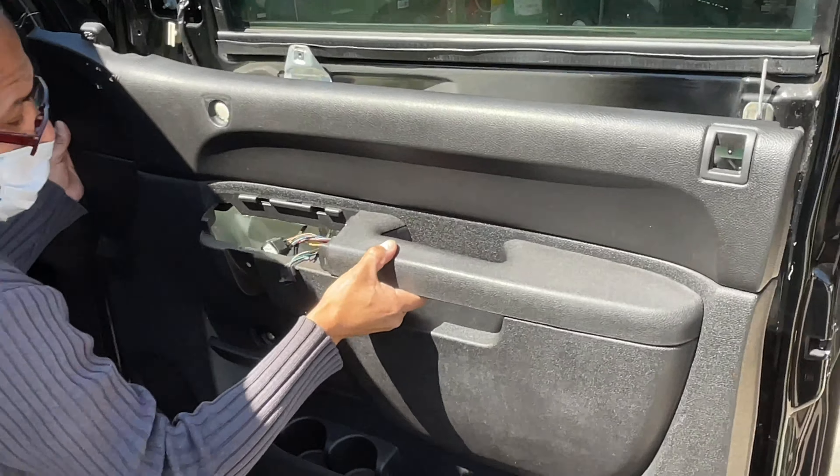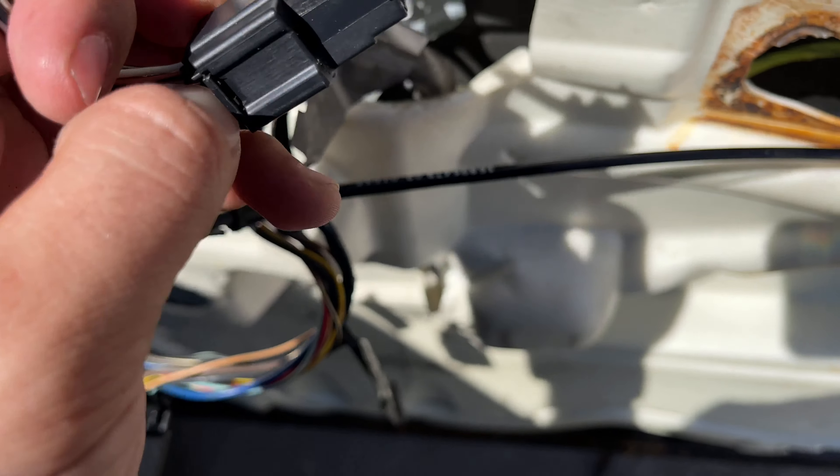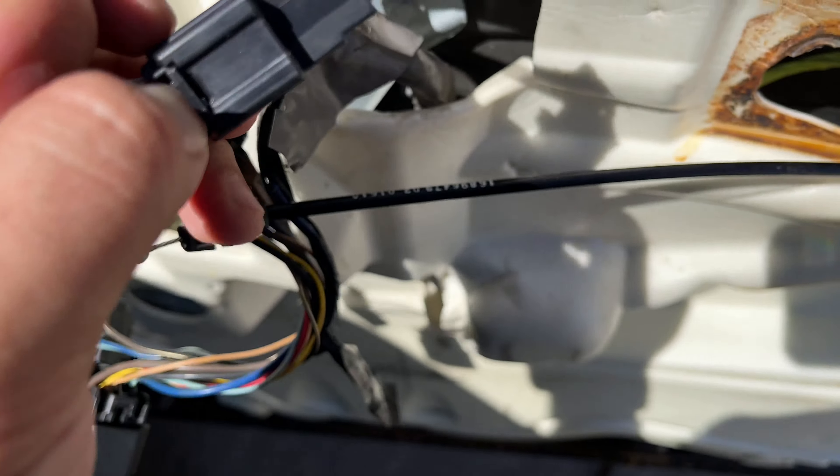Put your wires through — there's a clip right here, you may have to bend those little flaps. You can either push it in or use a flat screwdriver. In the back you're going to have the door handle wire. To get this out you're going to need some needle nose pliers and squeeze these two tabs in, which releases it. Pull it and wrap the wire up through there and it should just come off. That is how you remove the door panel.